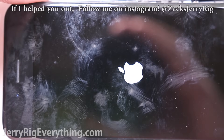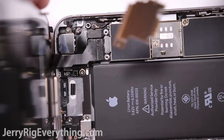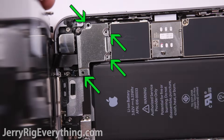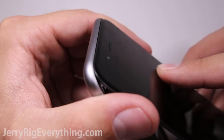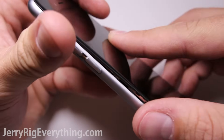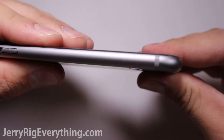All of my cables are connected correctly, so I'm going to lift up the screen. Make sure to turn the screen off before you lift it up. Set the metal plate down into place and put the four screws in — they are different sizes, so make sure you have them in the correct order. The best way to put the screen down is to line up the top first, tuck it into place, then slide your hands down the sides of the phone and latch it all the way down. Make sure to put those two bottom screws in as well.